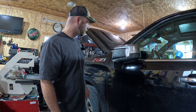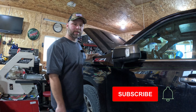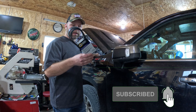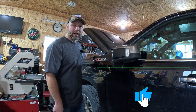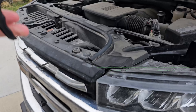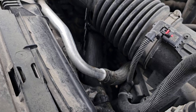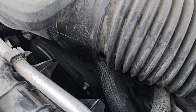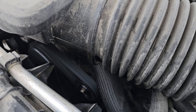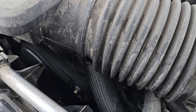Welcome to the channel. We have my 2020 Silverado crammed in the shop here — the serpentine belt has gone bad, and I'll show you how we figured that out. Using a little water, you can tell if it's the pulley or just the belt. You spray it on the belt and it gets quiet. As that water dries off, it will start squeaking again.